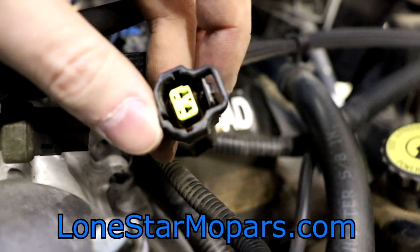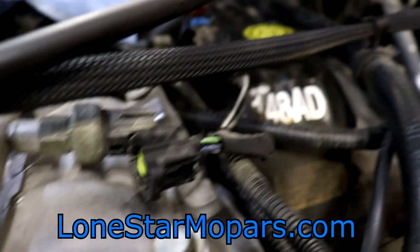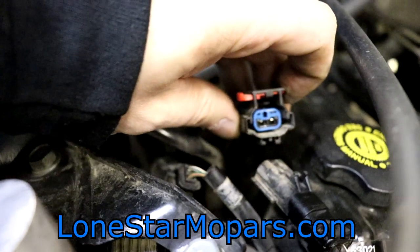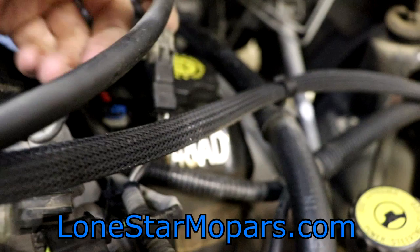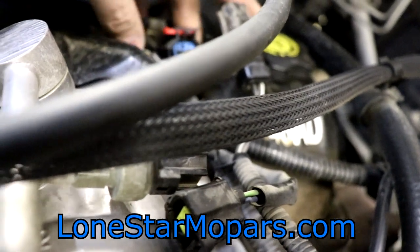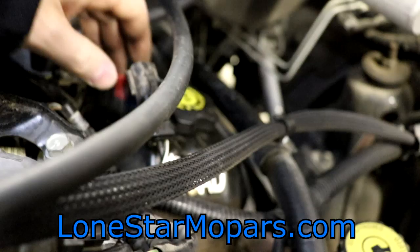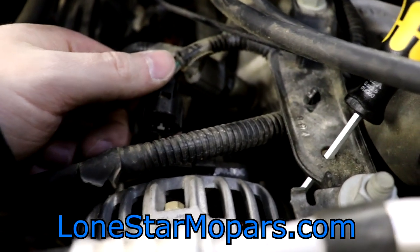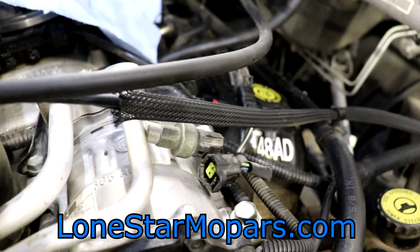On this side, the clip going up to the compressor came off super easy — it's kind of a fluorescent yellow, similar to a power steering cap color. It plugs right into the compressor. The other one has a red safety lock you push out to open; it's a blue connection with two red prongs that slide into the blue connector. When you make that connection, press the safety lock back toward the oil fill cap or master cylinder to lock it in place. The only tool I needed was the clip lifter, and that was just for the one I thought would be easiest.